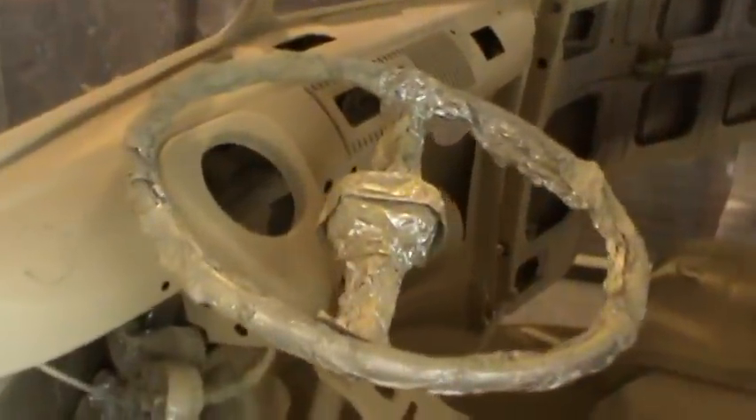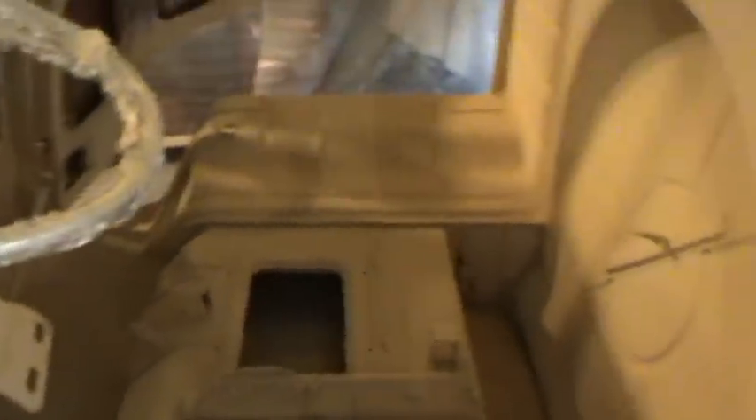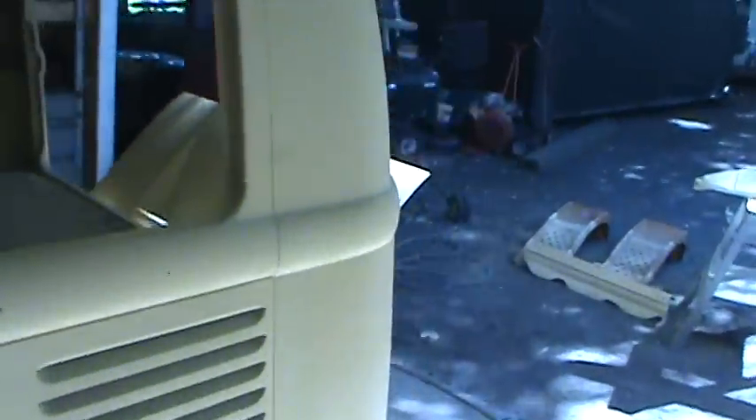Hit it 2 coats. First thing I did was I went around and hit all the jams and the interior of the dash. It's a truck so there's really not much interior to mask off or cover — plus the thing was stripped out anyway. Then I went around and hit the body twice and I was pretty much done. After that I shot the engine compartment a little bit. How's that for masking — towels, aluminum foil, and bags. It works.